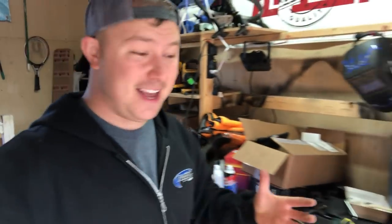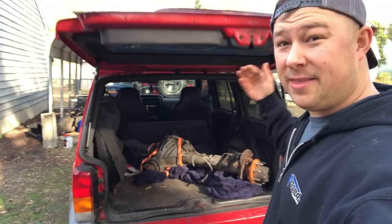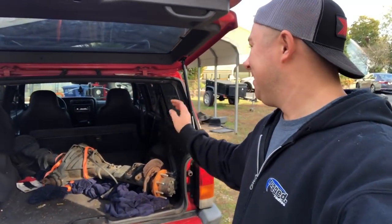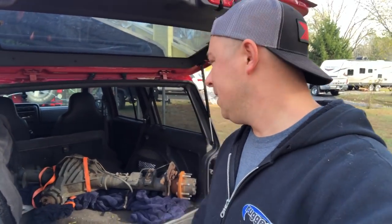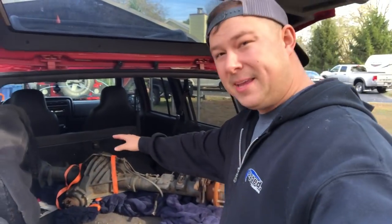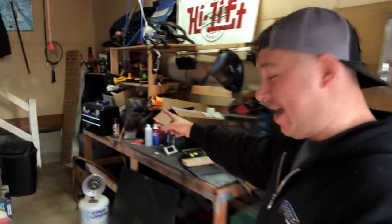This winter we are going to get the super duty 60 for the front. I decided not to go with the Sterling rear — the one also under the Ford — just because there is a gas tank clearance issue. I'm pretty sure on mine I could make it work, but there's a lot of scenarios where it's going to hit the gas tank, you'd have to go with an aftermarket gas tank, and it ends up being a lot more money than it's worth. So the more common route is to go with a 14 bolt. This has been in my Cherokee for a week because it's too heavy to get out by myself. This is like 600 pounds, but it'll be a lot better for the swap. It's a 14 bolt rear found in the 2500s, the Chevys — you want to get it from 1999 to 2006, ribbed casting. This thing is going to be beefy. I'll probably do a little shave kit because those offer horrible ground clearance. Between that and the super duty 60, axles are set up and good to go. We'll have to get the swap kits, gears, lockers, and a bunch of stuff — hopefully this winter, step-by-step exactly how to do it. We're going to try to keep it budget friendly.